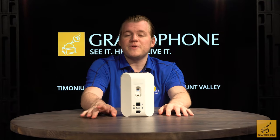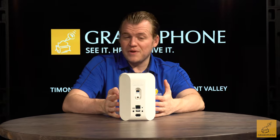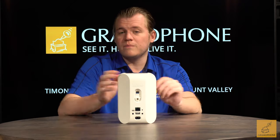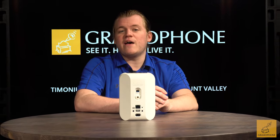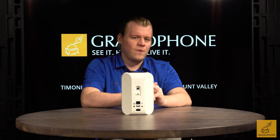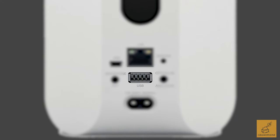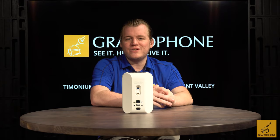If you look at the back of this unit, you can see the plethora of physical connections it contains. It's a smart speaker and you're generally probably going to be using it with internet streaming services, but Bluesound has not forgotten legacy devices or anyone who has a locally stored music collection. First and foremost, you get RJ45 ethernet for hardwired internet — I'd recommend it if available, but the Wi-Fi works great too. You get a combo jack that is part optical TOS link and part 3.5mm, so using a mini optical cable or a standard 3.5mm connection you can feed music in both digitally or analog — literally doing both digital and analog input in one jack. You also get a USB Type-A port for plugging in USB memory sticks with locally stored music, and even a 3.5mm output for headphone listening, so your portable smart speaker can actually function as a headphone amp.